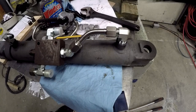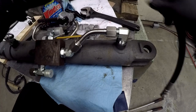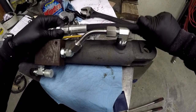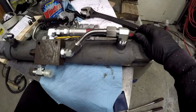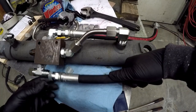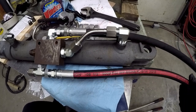Those will go there, and then our hose assemblies are just a female JIC swivel on the hose assembly. We'll have one that comes in on the side like that, just clearing the fittings — these will go to the valves right here, so we'll have a hose assembly there. And then our other hose assembly will be right here. So these will both go to the control valve.